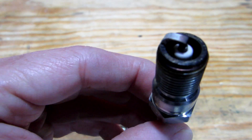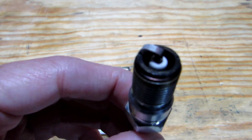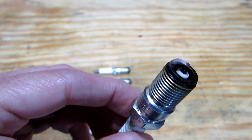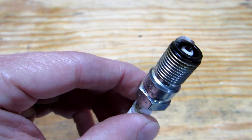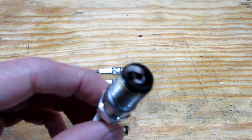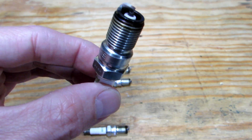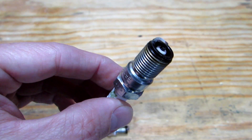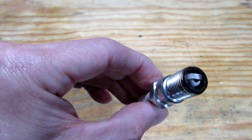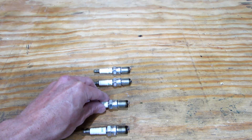You're getting detonation. If you start getting to the point where you're melting the strap, the tip of the electrode, or the porcelain has been melted, then you're way too hot and you've probably already caused damage. Really watch for those little speckles — any sign of that when tuning is a sign of detonation that maybe your knock sensors didn't pick up, or didn't react fast enough pulling timing. By the time they pull timing, it could be too late.